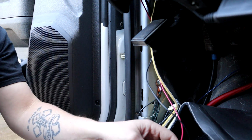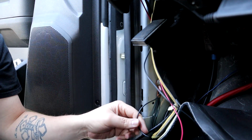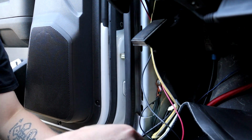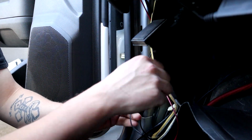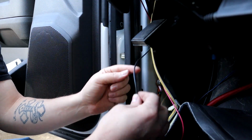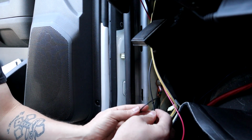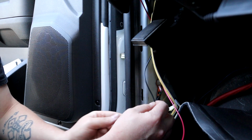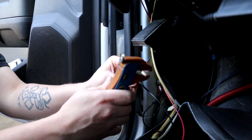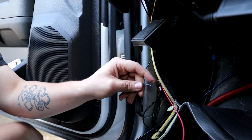And then we also have to hook our ground for our boost gauge to the same spot. That way all of our grounds are mounted to this location right here. So it looks like that should be coming down from our boost gauge, this one. We'll cut it down. We should be more than good about right there, roughly. So we'll cut that wire off, and then we can get rid of that mess of wire,